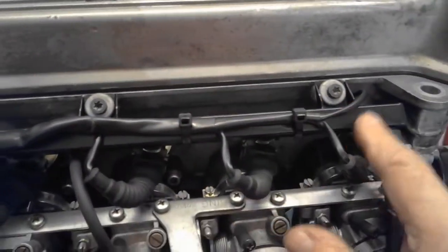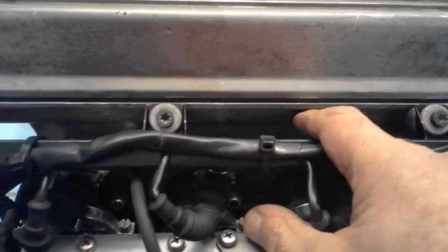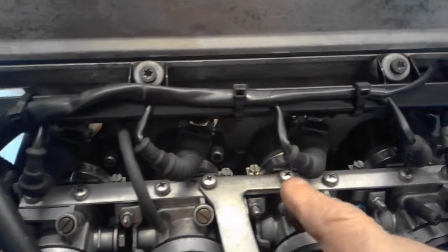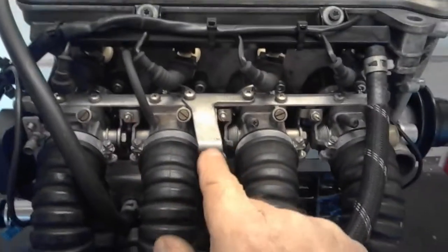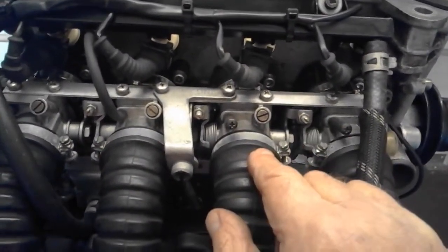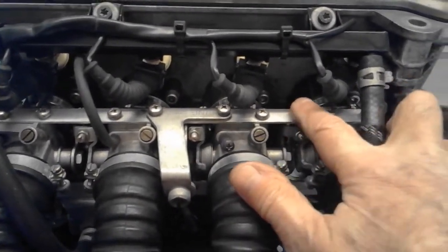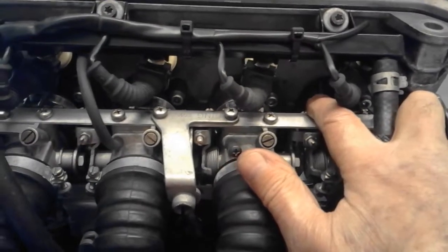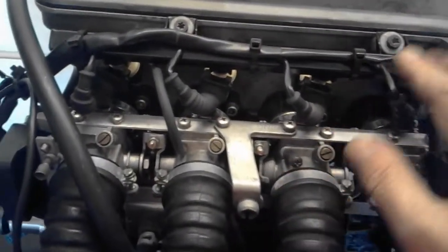It's an 8-valve head, so we're using 8-valve fuel bar, and the injectors go straight into the head right behind the inlet valves, which is quite a good idea. Standard injectors, but I'm going to use the 16-valve throttle bodies, which are bigger. I think they're 2mm bigger, which means we've got to use the 16-valve manifolds, but we've got to turn those around and slightly modify them, and modify the inlet tracks on the actual head, which I've done.